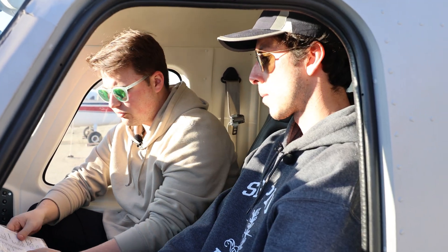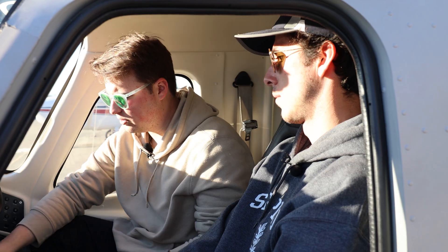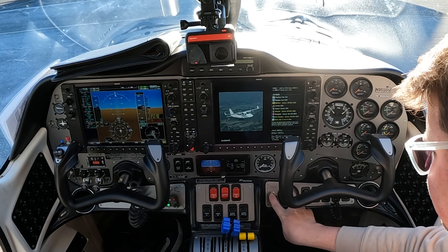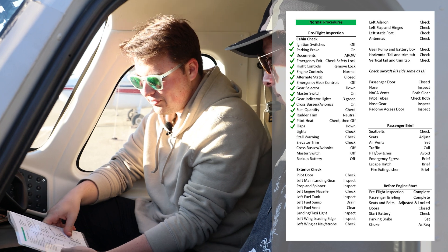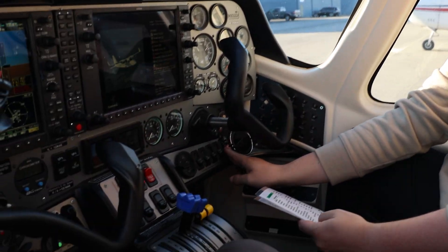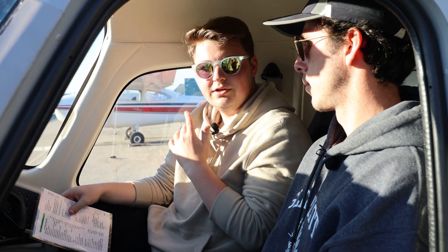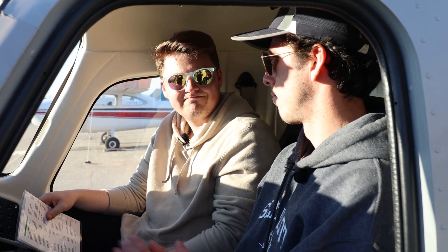Next, for the flaps, we're going to make sure we set our flaps to full down position — just to test that they can go down, and also to allow us to look at some of the bolts that hold them on. The flap selector is here on my side — I'll hold it until we're getting a down indication. See that little needle is all the way down? That's as far down as it's going to go. Flaps are down. Next, we're going to turn on all of our lights. The light switches are below my yoke. I'm going to flip all of them on except for the inside instrumentation lights, and then we'll go do an initial walk around to make sure all the lights are functioning and check our stall warning.